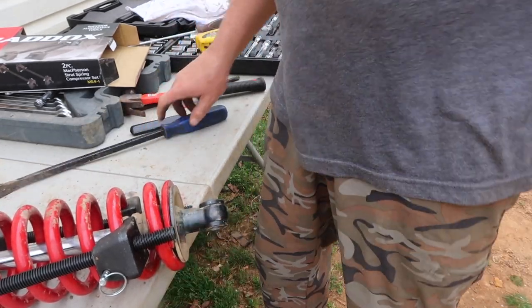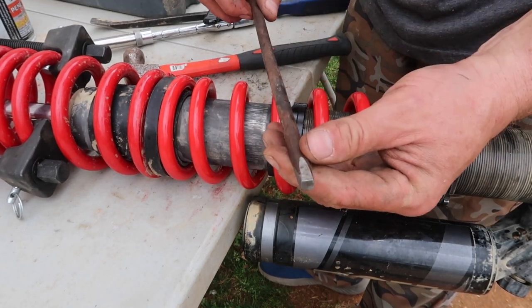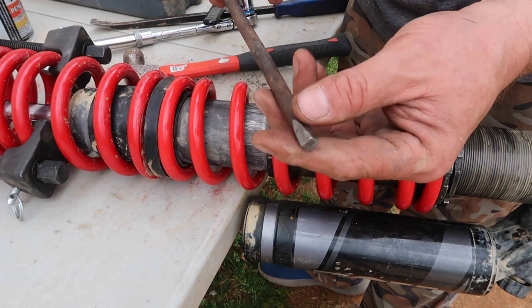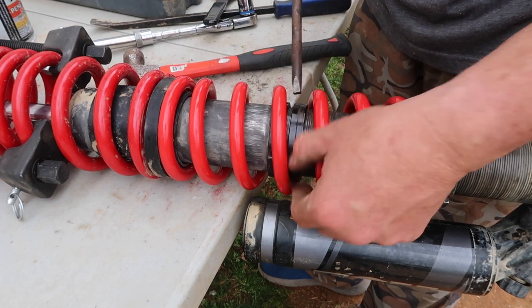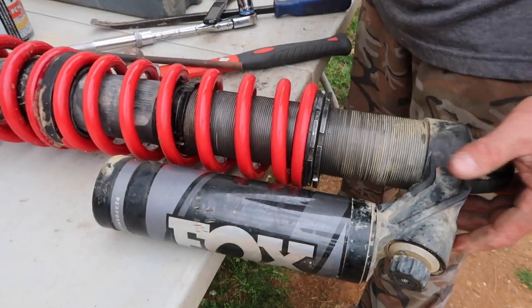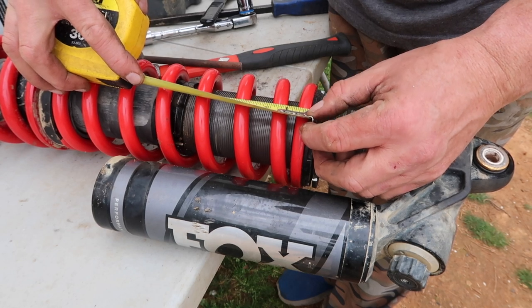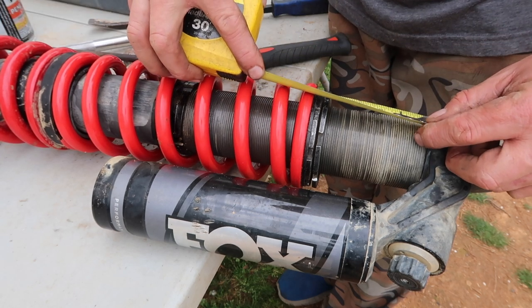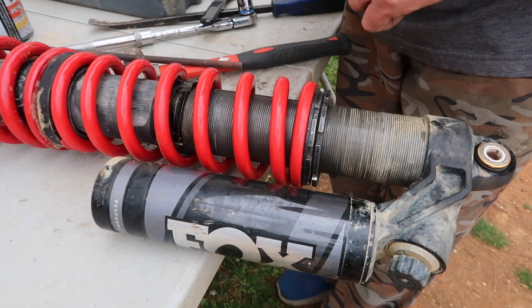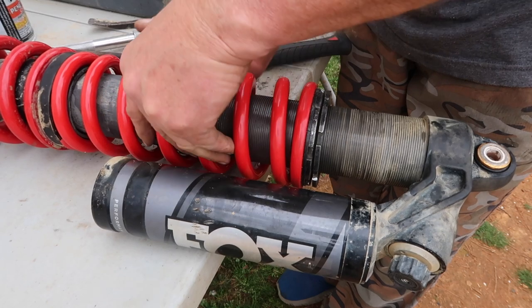Here are my crossover rings. What I've done is take a piece of round stock and flatten the edges on a grinder so I can hit it and knock it loose. I'm going to spin these and set mine four inches from the top of my spring. I got this one preset to four inches from the top of my spring to the bottom — four inches also. That's why I got the other side and it looks like it's going to do well. This is a two-ring system.